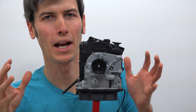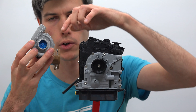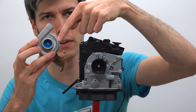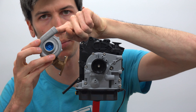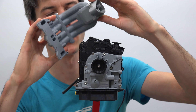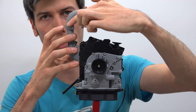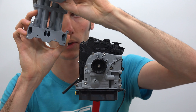Now let's walk through the airflow for this engine, starting with the intake and then ending with the exhaust. The air starts off coming in the intake portion of the turbocharger — you feed that air through a filter, then to the compressor side of the turbocharger. It will be passed out of the turbocharger, sent to the front of the vehicle to go through the intercooler, and then come back to the intake manifold. Here we have the intake manifold, mounted like so with your air coming across and then down through these runners and into the individual rotor housings.